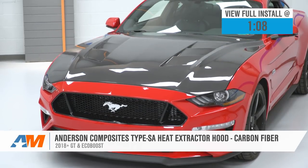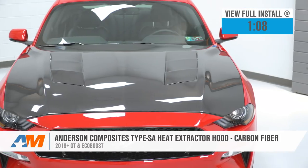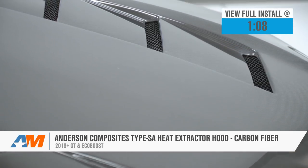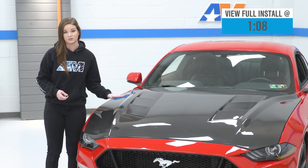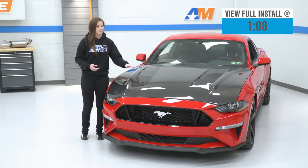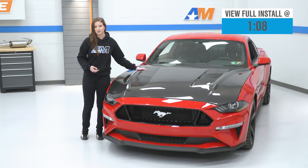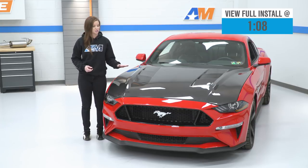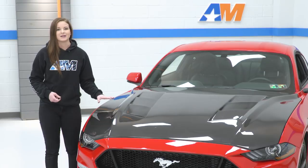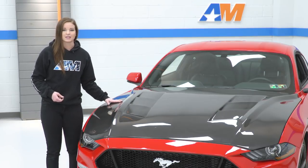This is gonna be a good option for someone looking for something different. Carbon fiber offers a very different look in and of itself, but take away the carbon appearance and the styling of this hood itself is also different. It's a heat extractor hood with large vents all the way up — there are three extractor vents on each side of the hood and they do have removable mesh screens in them that can easily be painted. This is a direct fit replacement and it is double-sided carbon fiber with a high gloss finish.